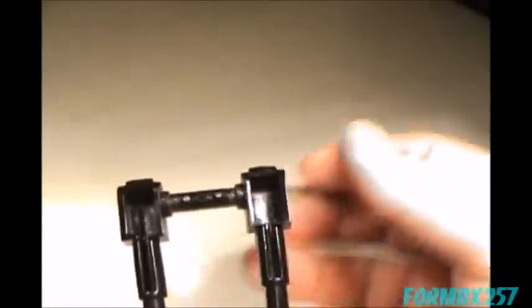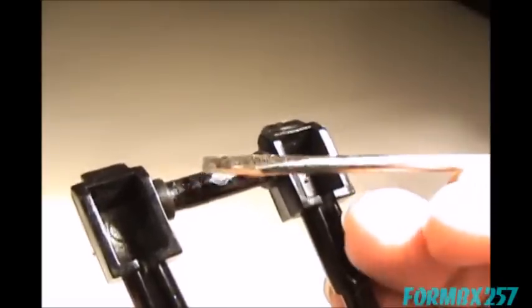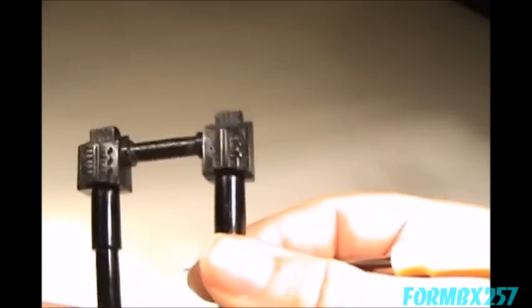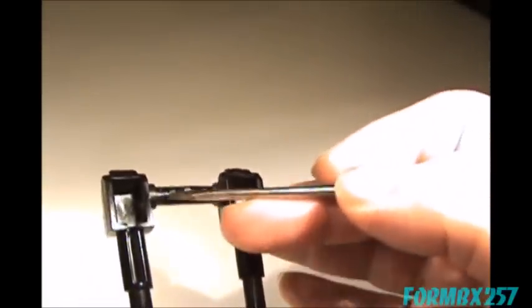On the cannon bars, you probably have what's left of the original plastic prongs — probably just some nubs left — and those are going to be your marks for where you want to put the holes. To be quite honest, I used to hammer holes in here, but this is about 27 or 28-year-old plastic. Quite frankly, putting any type of really hard pressure on this plastic is not a good idea anymore. What I've discovered is that you can actually melt holes through this plastic.